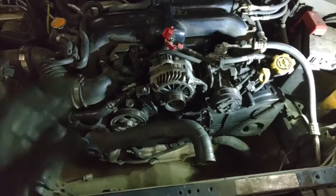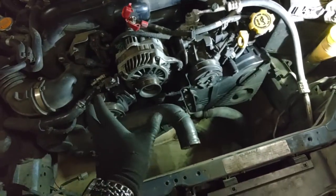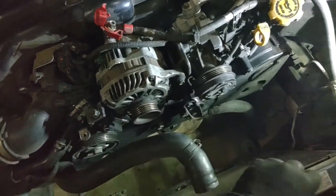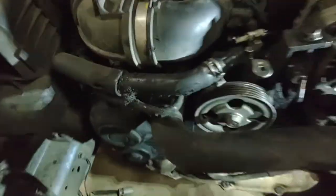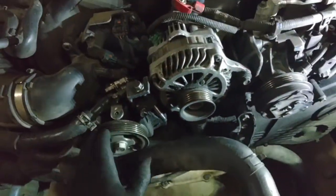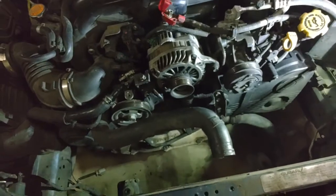This segment covers actually pulling the alternator out. Go back to my previous video for removing the accessory belts and the cover to get to this point. If you're only doing the alternator, you don't need to remove the AC belt — just the power steering and alternator belt. You may notice a lot of black grime — in that previous video you'll see my alternator and power steering belt got shredded. You can see it in the teeth, so the whole area needs to be cleaned up before reassembly.